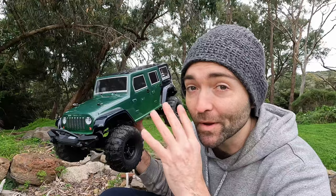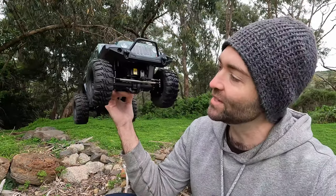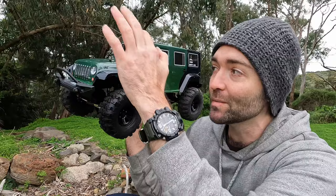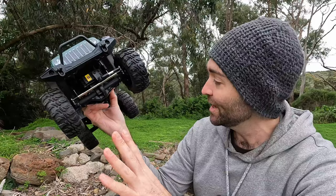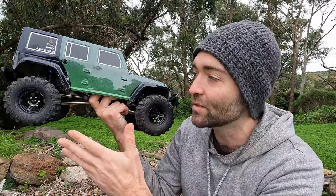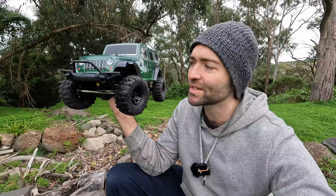We've made a bunch of changes. I spent four hours the other day fixing this thing up. 110 gram wheels with Tiger Dog tires, vastly better steering now. We've done some cutting away. We've lowered the actual chassis by moving the shock mounts up, lowered the body by moving the body posts down, and brought the bumpers in. We've spent minimal money — say 20 or 30 bucks for the wheels and similar for the tires. Even just getting the center of gravity improved will have a good effect, and getting that steering fixed — it needed that.